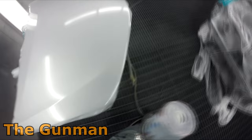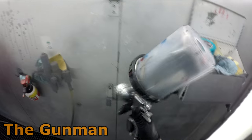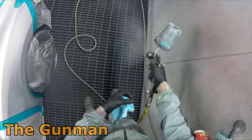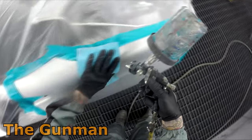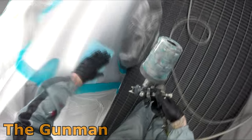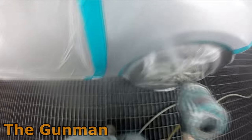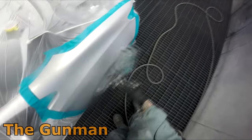This bonnet really did look absolutely amazing. One thing to mention when using water-based paint: be extremely careful of bare metal. You cannot paint water over bare metal — it's going to rust. So always use a bit of 1K primer, a bit of wet-on-wet. These are blend guards with no cut-throughs whatsoever. There was one little patch where I had to put a bit of fine filler — a very tiny stone chip — but I didn't go back to bare metal so I could paint straight over it.